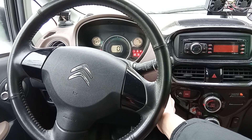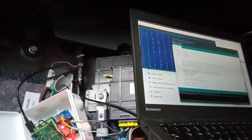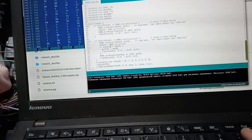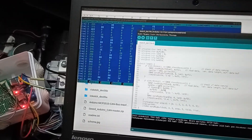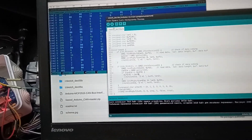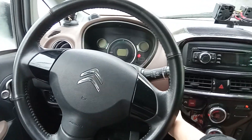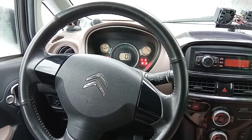Powering on the vehicle — it says 55 kilometers. Switching off the ignition. Now let's replace that 0x57 value with something greater, like 0x70. Writing this into the bridge again. It says loaded — now switching on the ignition.